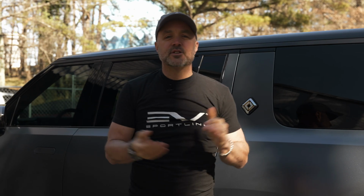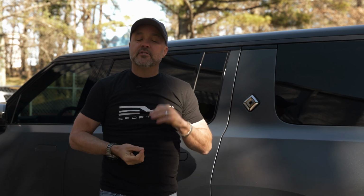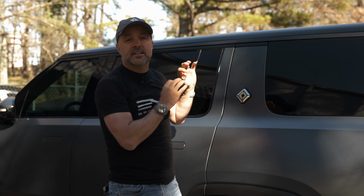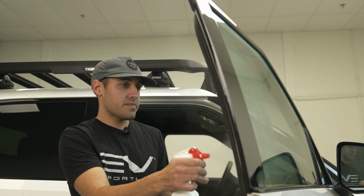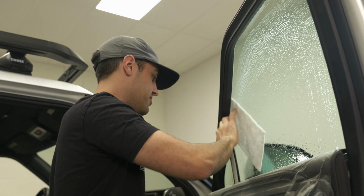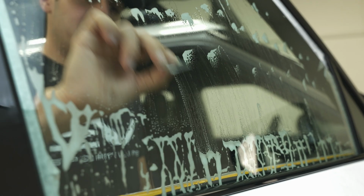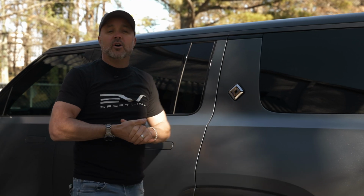So what does installation look like? You need to watch our videos step by step and we go through the details, but the basics are simple. First is cleanliness. You're going to wash the truck, you're going to really clean the windows. We provide a razor blade and a scuff pad so you can definitely make the windows clean and ready to go. We pull some window trim off the doors, which is easy. It's just pulling a seal off.